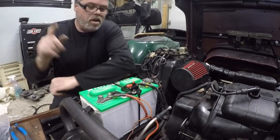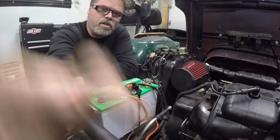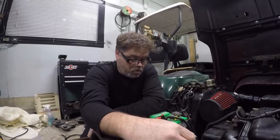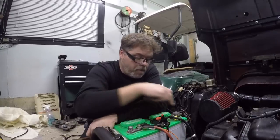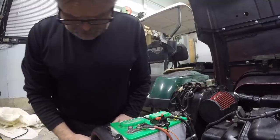I also found out the alternator generator - I think the regulator's gone on her boys. That's why she's making 16.7 volts. And Sean also talked about that. And I'm gonna get what they call a 12-volt battery stabilizer, so it will hook up the positive negative and it will only allow 14 volts into the battery. So I got one of them coming.